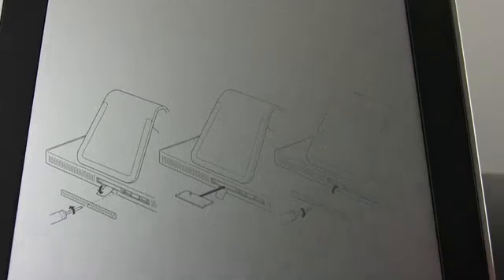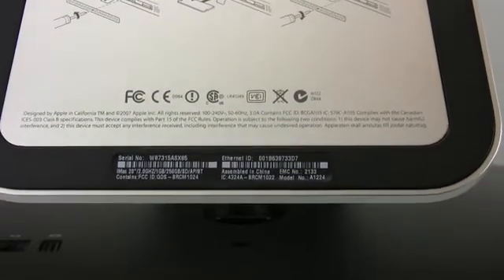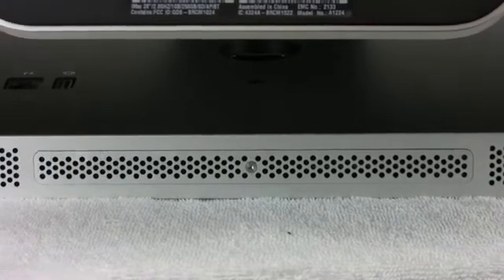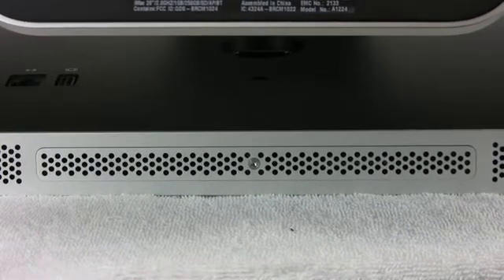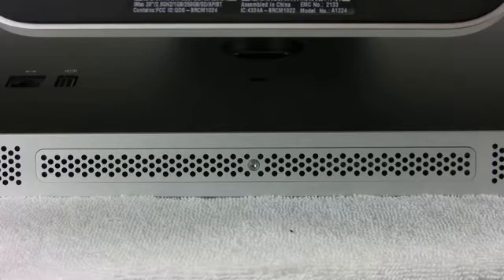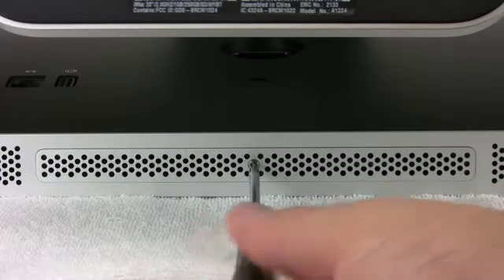I'm going to lift up the foot here — it's hinged — and tilt the camera down so you can see the cover. Right here is the cover. There's one Phillips screw in the center, and Apple has chosen to use a larger Phillips screw than they do on the majority of their computers, so most homeowners would have a screwdriver that would fit, like for a drywall screw. That would be a Phillips P2 or a P1. I'm going to take my screwdriver and remove the plate to expose the memory slots.